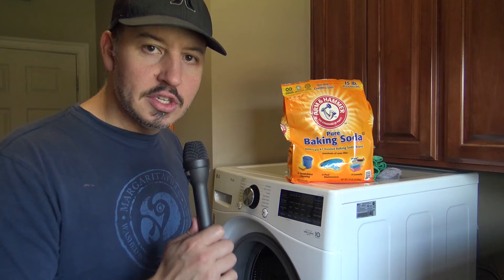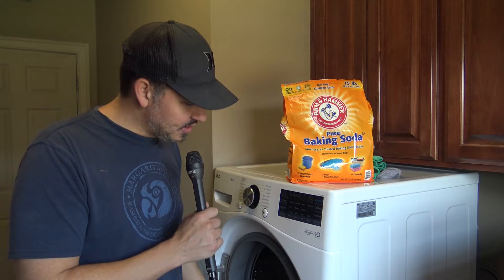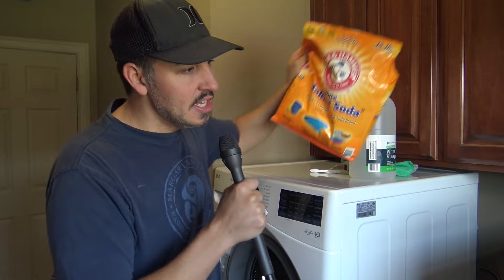What's up with the baking soda? Why are we putting two cups in the drum? Well, it's very simple — this serves as a mild abrasive. It's going to clean and deodorize the inside. After the baking soda cycle is finished, set that off to the side. We won't need that anymore.